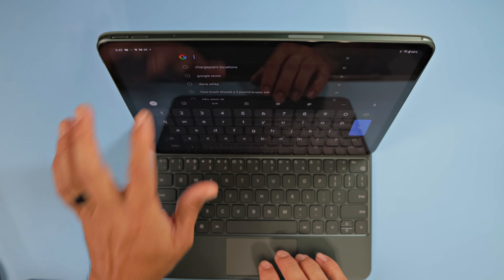I'm not sure why it's still showing the virtual keyboard when I have a physical keyboard. Once you install the keyboard, there is going to be a firmware update — make sure to update that. When clicking on the search bar, the virtual keyboard will still pop up, so you have to go into Settings, then Additional Settings, then keyboard input method, and under OnePlus Magnetic Keyboard, disable where it says 'use on-screen keyboard,' because you don't want it blocking your whole screen. I did have to go into settings to do that.